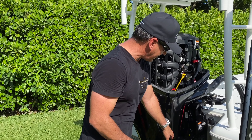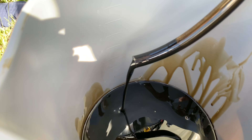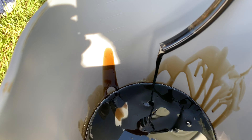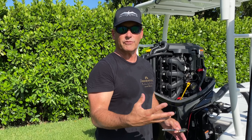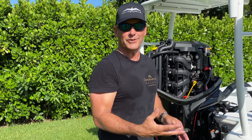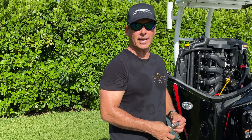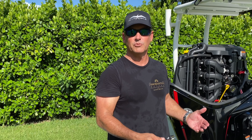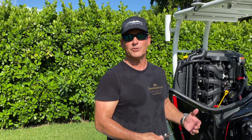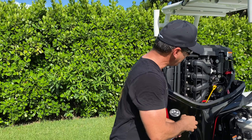At this point we're draining about five and a half quarts of oil into this bucket. It is dark, but it's only actually 85 hours on this oil change — so even though it looks dark, it's not a bad thing. But we are going to be replacing five and a half quarts with fresh oil and a fresh oil filter. It takes a couple minutes to drain, so we're going to move on to the next item assuming the oil has already been drained, and we're going to remove the actual filter.